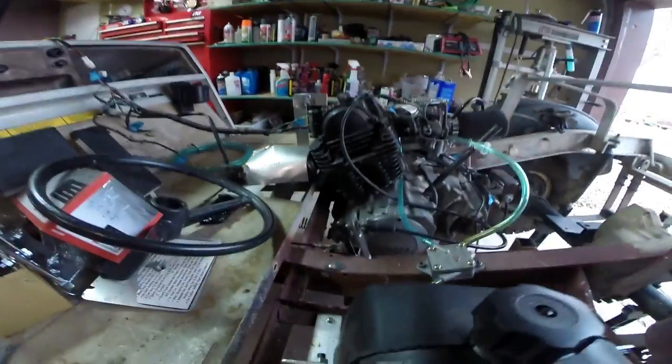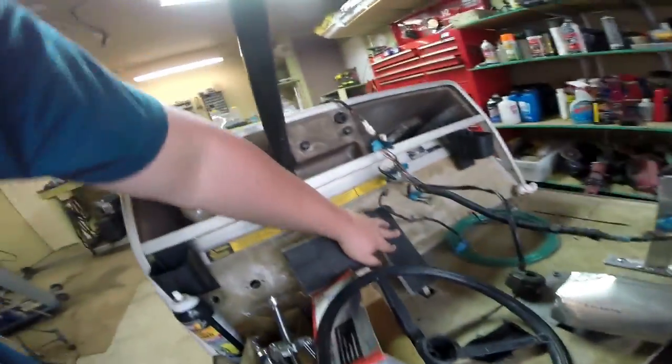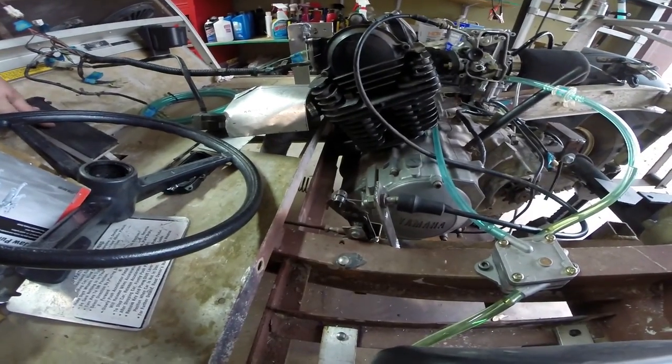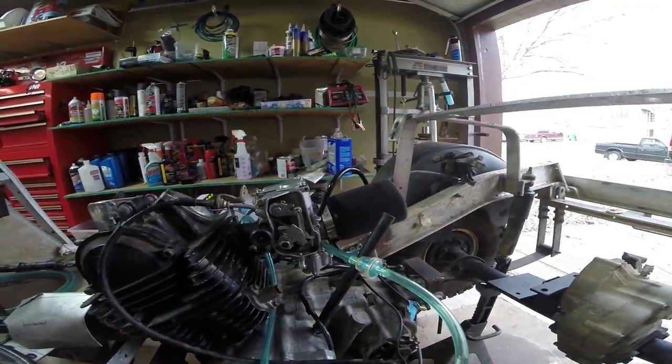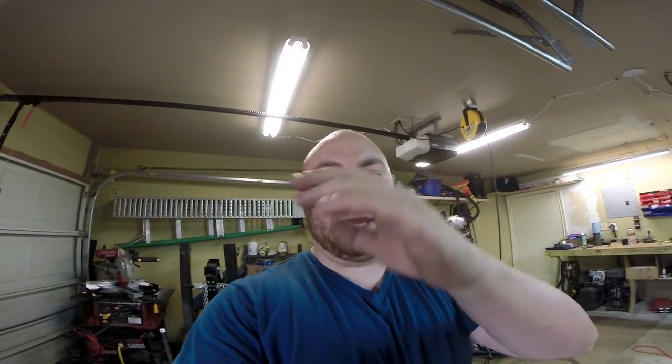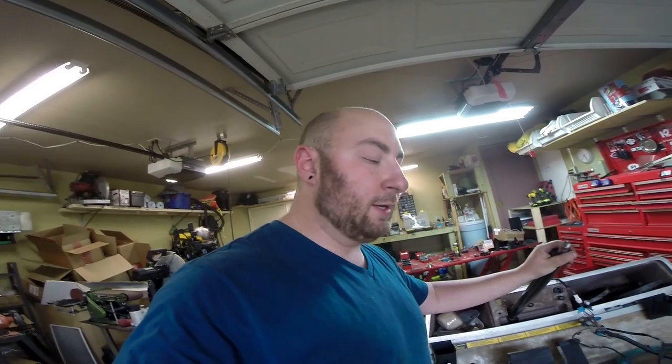After about two hours we now have a throttle linkage. This convoluted thing uses a bearing surface in here — I custom fabricated all of it out of random pieces of steel. The golf cart pedal pushes it, it pivots down — I had to grind down a piece of the frame to make it work — but you get the full travel and the full effect. The idea is you have a pivot in the middle: force comes this way and you want it going that way, so you build a pivot arm. Another major system is done; I actually sprayed some fuel and got the engine to run.